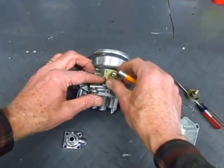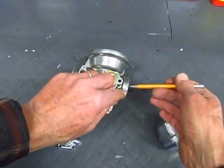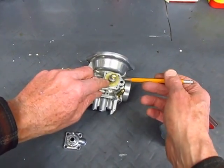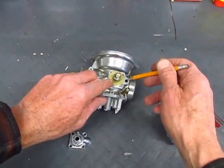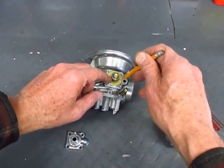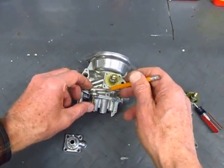The reason the fuel can go up is because we have a vacuum. We're pulling a vacuum not only to pull the air into the housing and down through the oval hole, but that vacuum is expressed through that passage and creates a vacuum that pulls fuel up out of the standpipe.